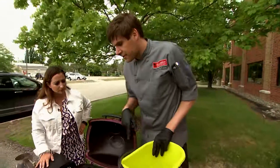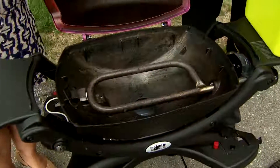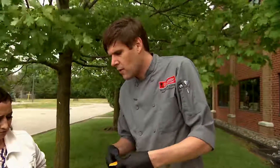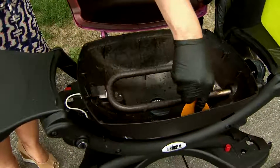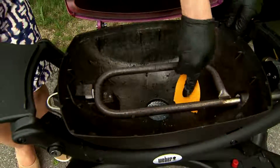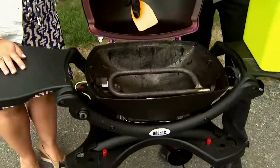Inside, you've got a cook box. Whether it's this petite one or your big gas cart in your backyard, what you want to do is get a few of these plastic scrapers — not the metal. You don't want to be digging into the metal. Just take a scraper like this and start working out the inside of your cook box, channeling all the debris down into your grease management system, your drip pan.